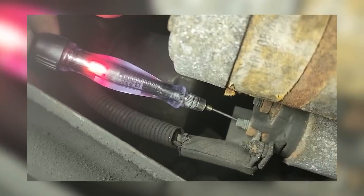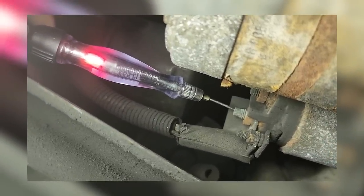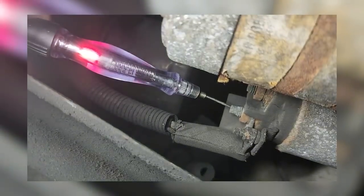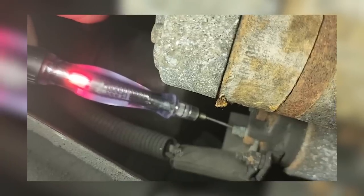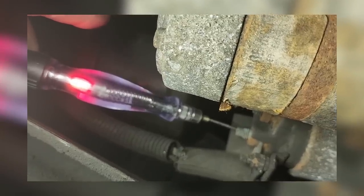The second common issue: when you check that hot cable at the battery post, that circuit must be loaded for the test to be accurate. It's not good enough to just check it static without cranking the engine over. You have to hold the key in the crank position when testing that wire to see a voltage drop.